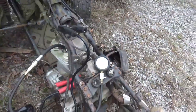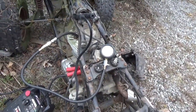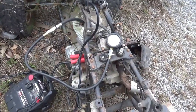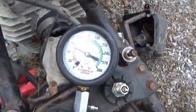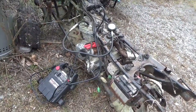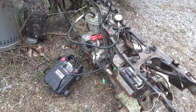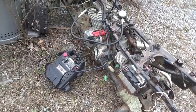What is that? Around 80. 80 is close. 80 means that it's obviously a wet 80. I put oil in there. The valves are already loosened, so almost 90. I don't think I'd write this engine off yet. I think it wasn't turning over crazy quick. If it was turning a little quicker, it probably would have crossed 100. I think this engine probably is savable.